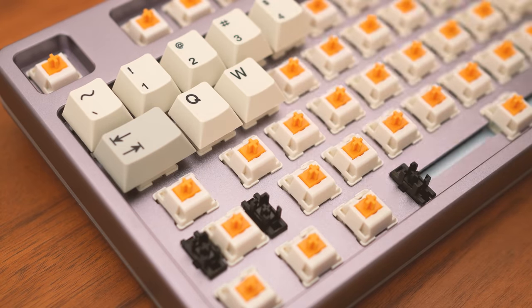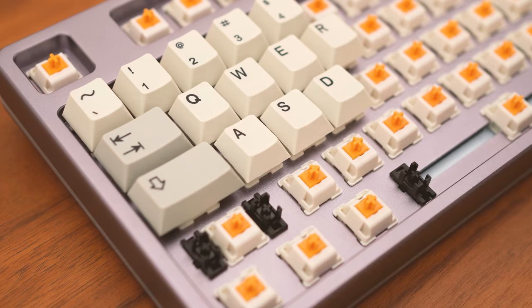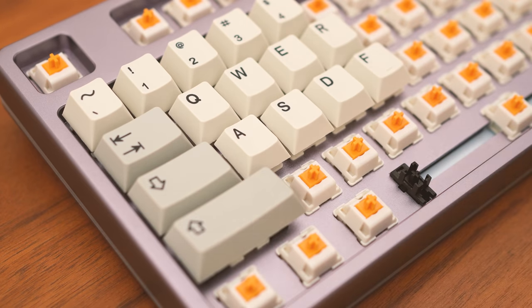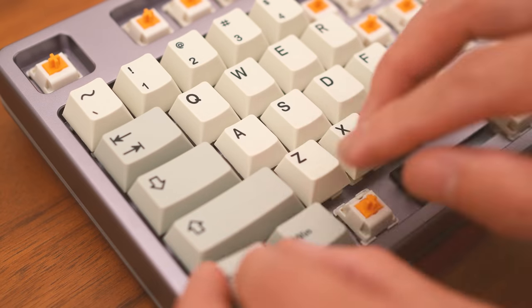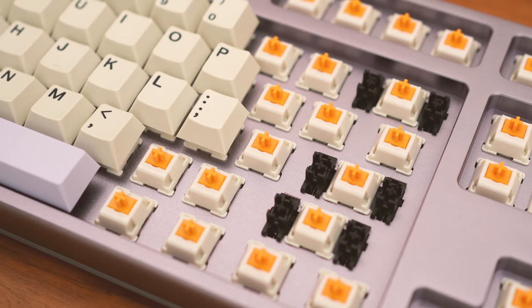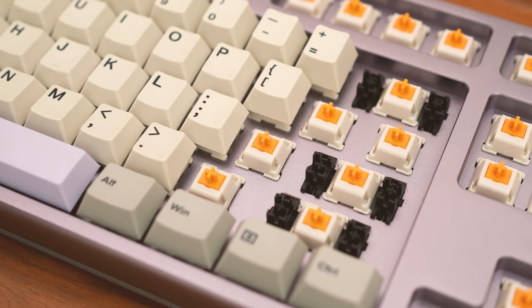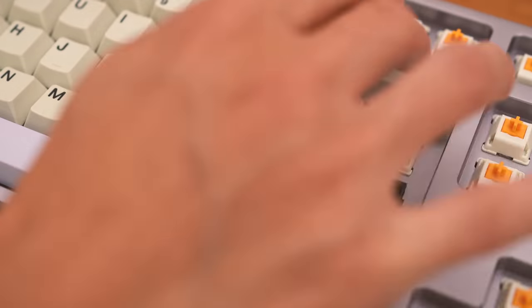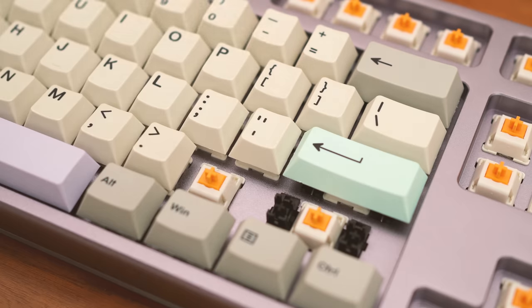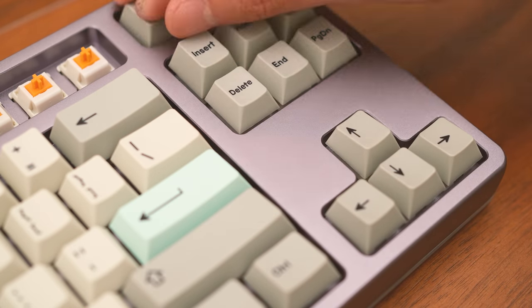The caps we went with are HK Gaming Dye Sub Thick PBT caps. I will provide the links in the description. Yes, these are Cherry profile caps, and yes, this board is north-facing LEDs. However, I did not see any glaring issues with the housing and cap interference in this situation. You can also listen for it yourself in the typing test video and pay attention to the Enter key on R3 to see if you hear any problems.